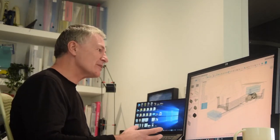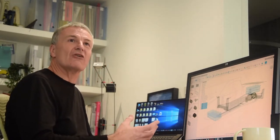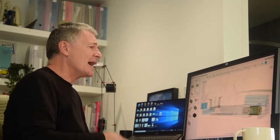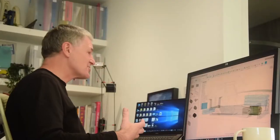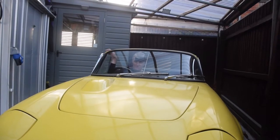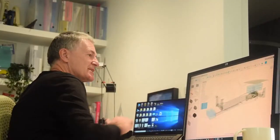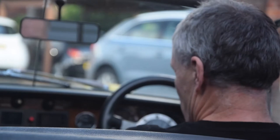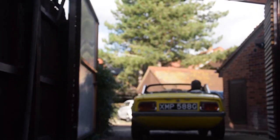Often when you're doing an electric conversion the hardest part is keeping the weight of the whole system down — you've got some relatively heavy batteries plus motor. What I worked out was that an Elan motor, and in fact generally many car motors, weigh about 125 kilos, and these five Tesla modules also weigh 125 kilos. So I could effectively swap the motor for the batteries, and this combination of five Tesla modules plus the 60kg motor came to the same weight as the original petrol drive system.